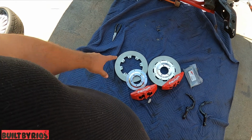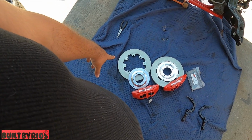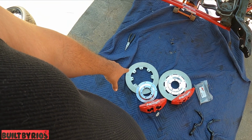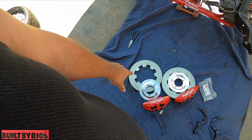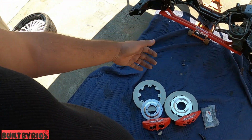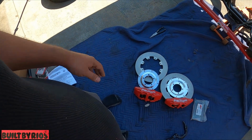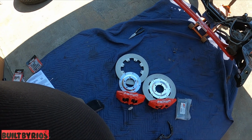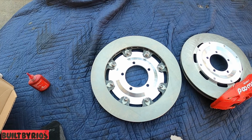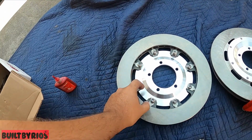All right, so let me get started on this one for you guys. It's 7 bolts at 25 foot-pounds. I'm gonna use thread locker. I'm gonna put them on, thread lock them, and it's gonna be 25 foot-pounds. All right, so that's the 7 bolts.